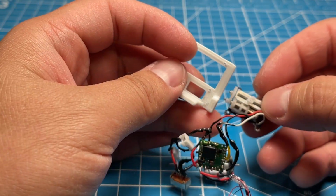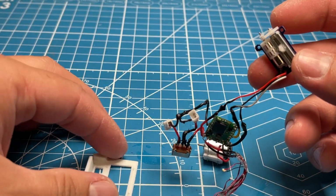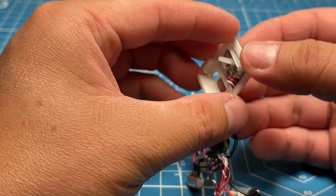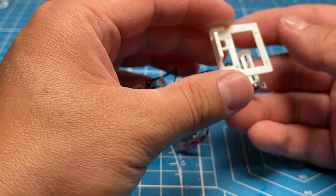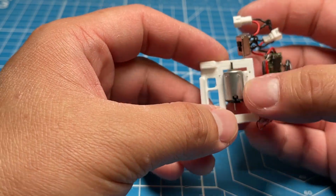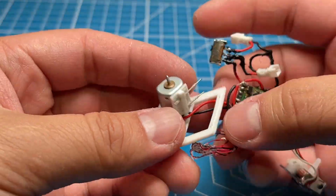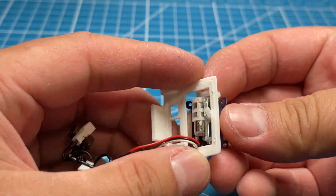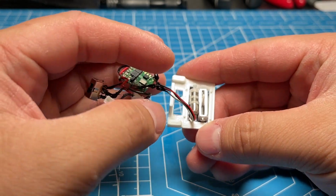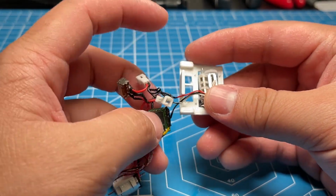A little bit of a dilemma. I think instead of soldering this directly onto the lines, I should have done it differently. The servo is supposed to be mounted from underneath on the bottom side, and I don't think I can do that because everything else sits on top. So what I'm going to have to do is feed every component slowly through, and after feeding everything through, I can mount the servo. Now I don't have to worry about the wiring being on the outside. It's going to sit right here, so I won't have to worry about the wires being pinched between the chassis and the car.